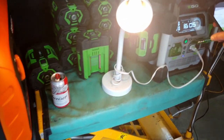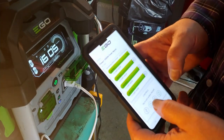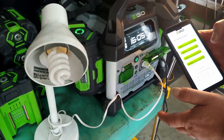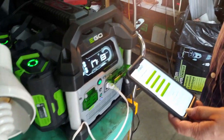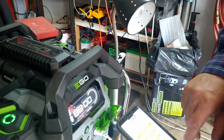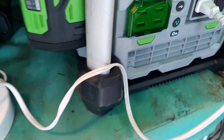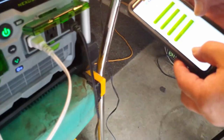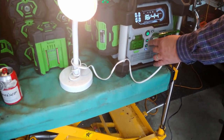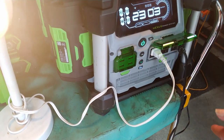Let's say I'm laying in bed monitoring via the app. If my batteries get low — let's say number one is my freezer — I could decide it's sacrificeable: if I keep the door closed it'll stay frozen, and that'll allow more run time off my other plug, which I can also turn off remotely. Same with the USB ports — it comes with four fast charge USB ports. I can turn those on and off by hitting the button on the phone, or manually from the face unit if my phone isn't working.